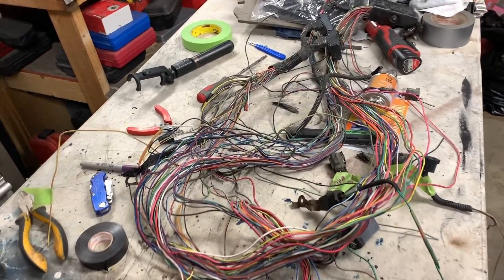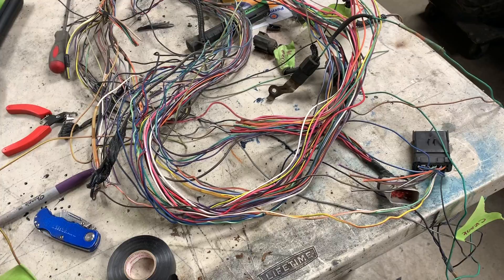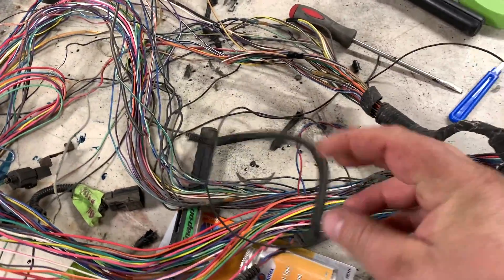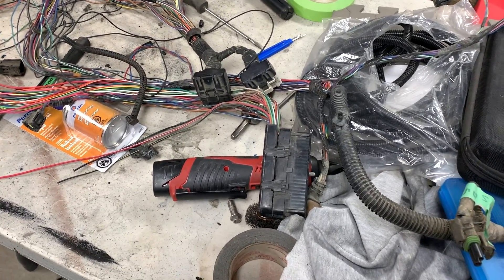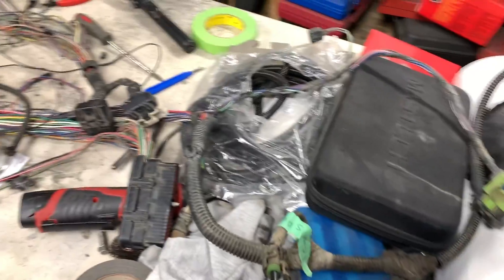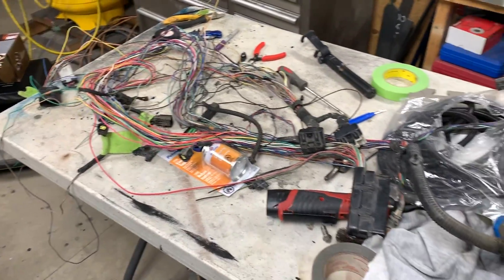Alright everybody, it's time to shut it down. I probably confused you quite a bit — like I said, once this is all done 75% of the harness will be gone. The next step is going to be hooking it up to power, and a few things we've got to figure out yet: one is the neutral safety bypass so the ignition for the starter will work, and I need to figure out if there's a brake interlock wire that goes to the transmission wiring harness so we could use that for the torque converter lock-up for the LS swap, and also which wire, if any, will correspond to backup lights. Hope you guys enjoyed this video — I'll see you in the next one.